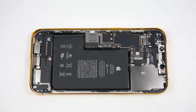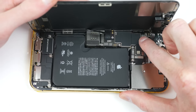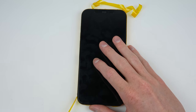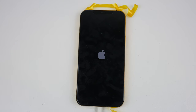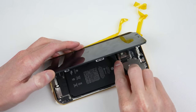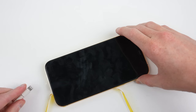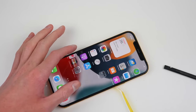It's finally time to test our custom phone. I'll loosely attach both the battery and display — it's vital to ensure the phone is working before we glue in the battery and display, as we risk damaging the phone opening it back up. Pressing and holding the power button, nothing happened, but I expected this, as I've encountered the same thing with other iPhone 12s after repair. I'll need to plug it into the charger to get it to switch on. After doing so, the phone sprung into life, but the touchscreen wasn't working. I reseated the display's connection and tried again — it was just a simple unplug and replug that fixed the issue, highlighting the importance of testing before closing up.